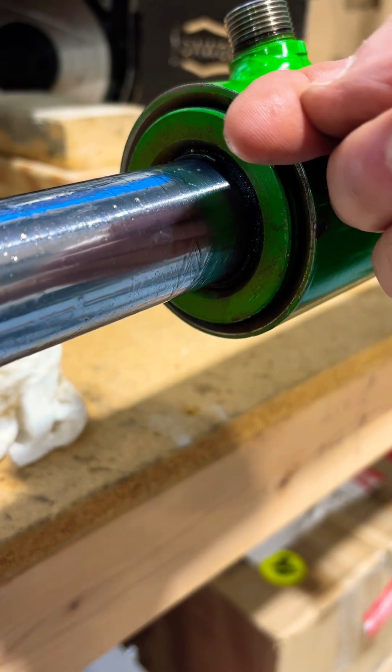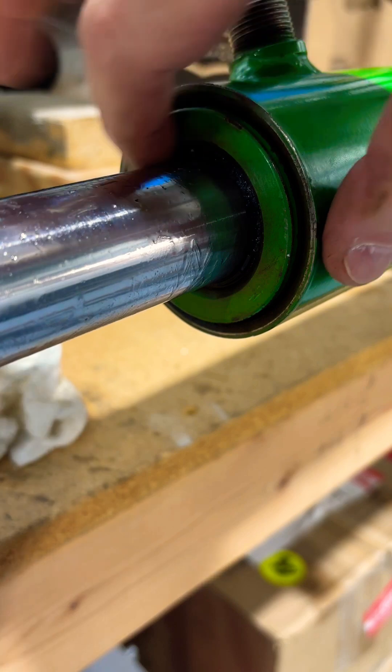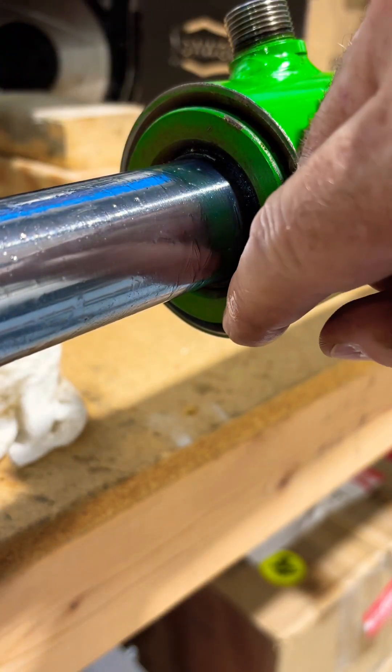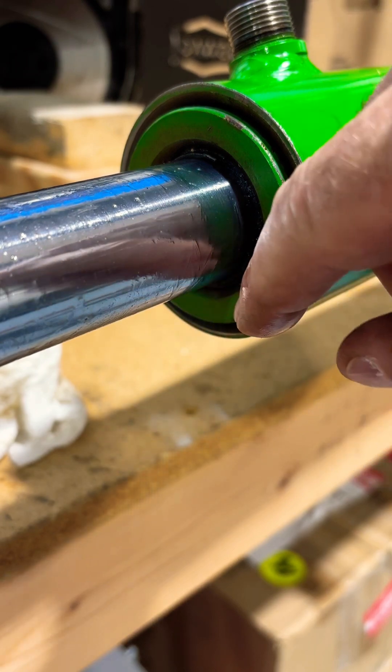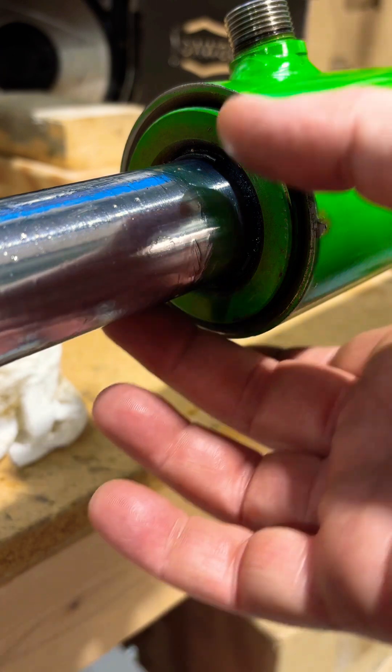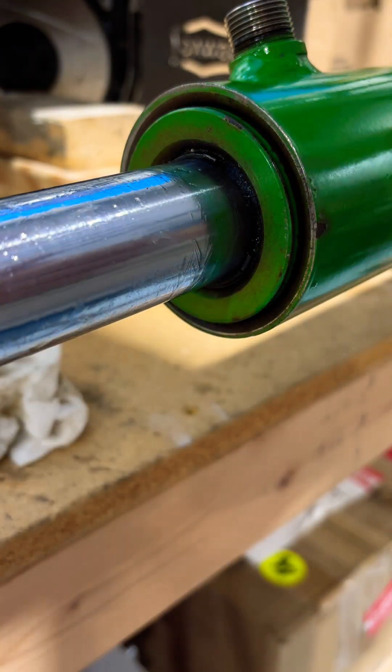You can't get it off by just pulling it out. This area — this land — has to be pushed in to access the groove for the inner ring, so that a tool can be placed in there, allowing it to fill that groove so that the piston can be pulled out easily.